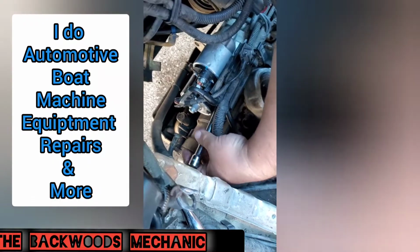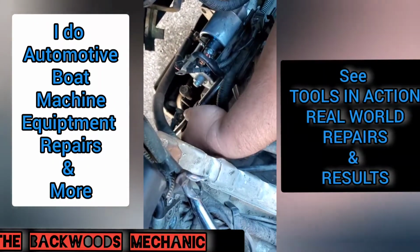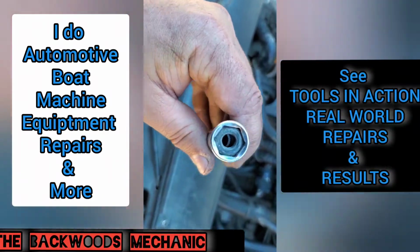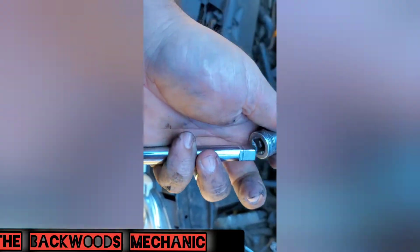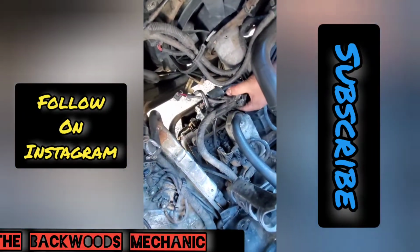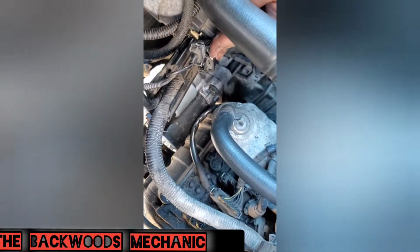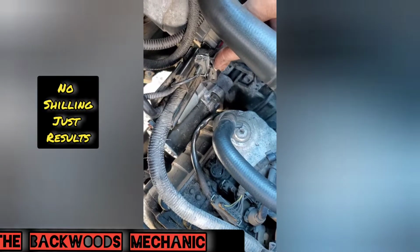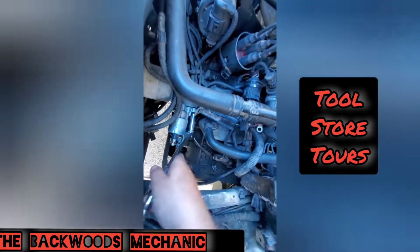Now that it's loosened up, I can finish spinning it by hand. And then set it up here out of the way. Get our 16mm, which is going to be the size of the inside fastener. So we got our socket ready for that. We'll go ahead and pull this wiring harness off right here. As you can see, I pulled that harness off, and now right there you can see your fastener plain as day. In this situation, I just moved the wiring harness there out of the way.